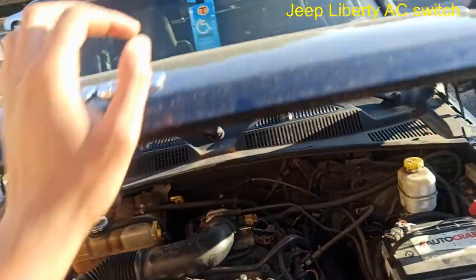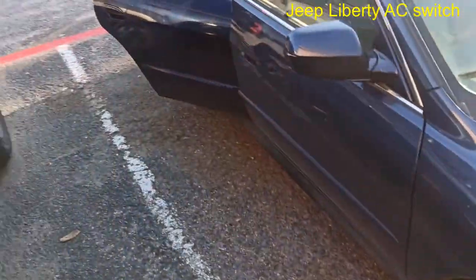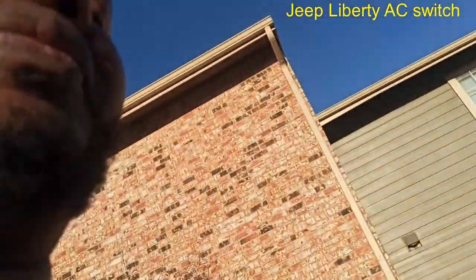But like I said, I would advise, when you're doing this type of AC job, especially replacing the compressor, and this is even in the manufacturer's warranty policy, that you also replace the condenser, and that you flush the lines, right? So when I took out the compressor, the lines, I see some black stuff around it. It wasn't caked, it wasn't gooey, but it's still there. So you got some type of metal shavings in there. They can be fine, but it's still in the system.